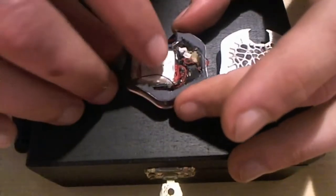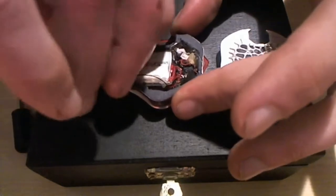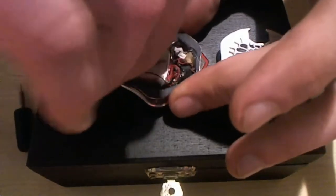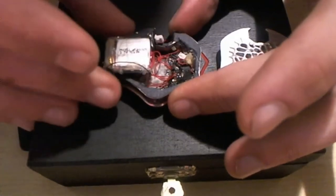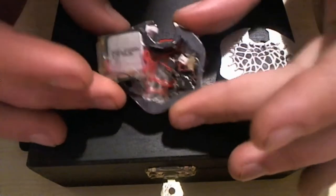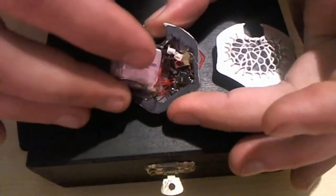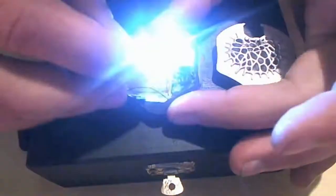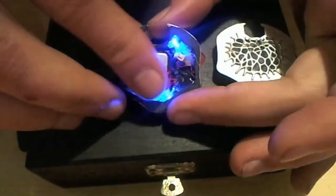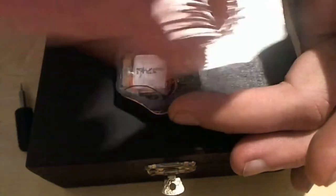There's a little plastic tab on the battery. You just pull on that to lift the heel of the battery out and pull it out. Attached to the battery you've also got the magnetic reed switch, which is wired in there. To plug it in, you just connect the Molex connector and push until it snaps in. The lights will turn on to show you that it's powered up.